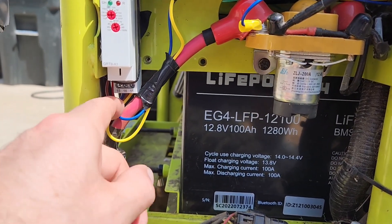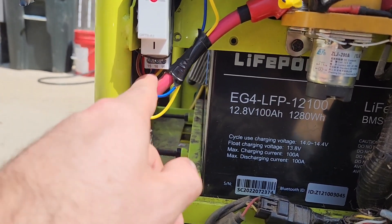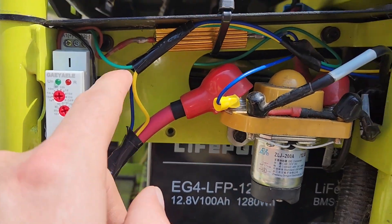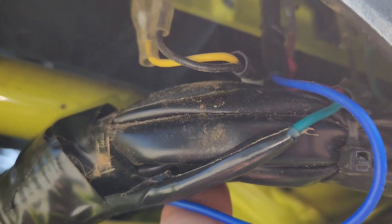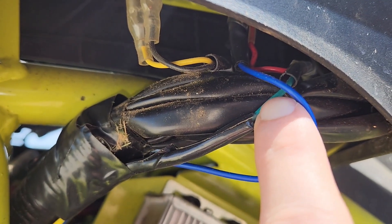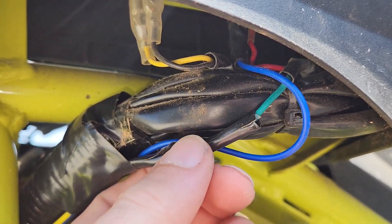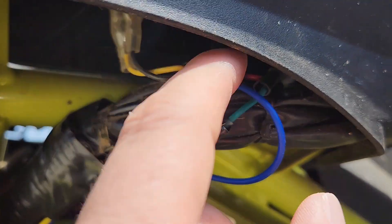After the five seconds, it switches to powering terminal 18 and shifts off power to 16. Terminal 18 is the yellow wire — it goes all the way back up to the key and plugs into the original key source. I taped it up and taped over it to give it some protection from rubbing.